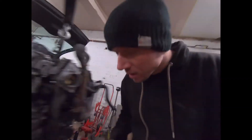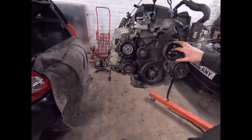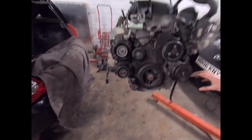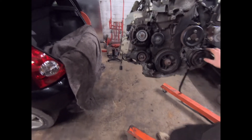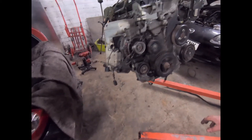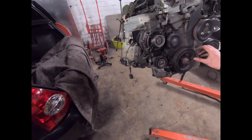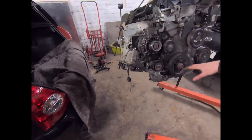Before we can do that, we've got to take off all the water pump and rocker cover because that all mounts to it by the looks of things. The air-con pump — might get away with it, might not. Most of this will have to come off, and then we can get the sump off, the main pulley off, and this entire timing cover.